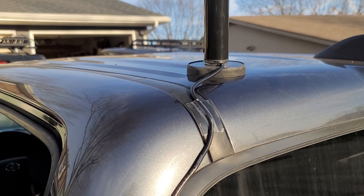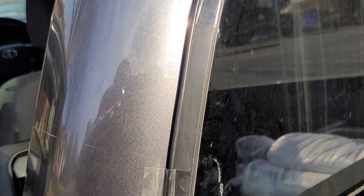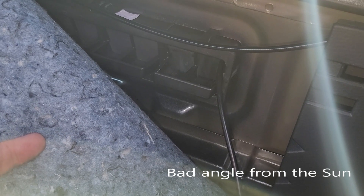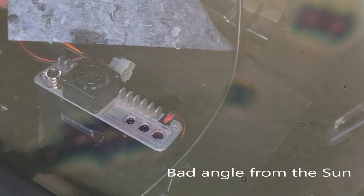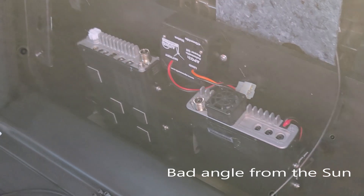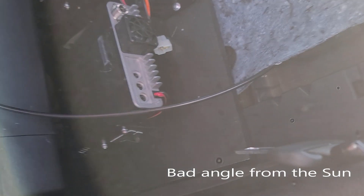I've got the 2-meter, 70-centimeter Cantena installed and routed the cabling down, using some relatively transparent Gorilla tape. I was able to route that cable through the cab vent in the back. The Tacomas and some other vehicles have vents in the sides or back, so I routed it down between the cab and the bed and managed to grab it with my fingertips and pull it through. The opening was big enough to accept the SO-239 connector, so it comes right in through there.